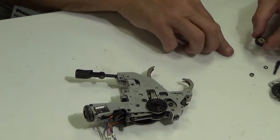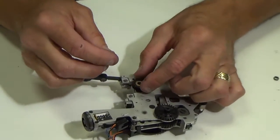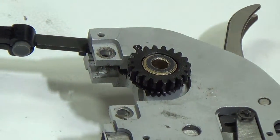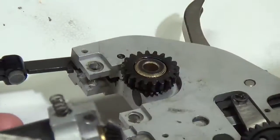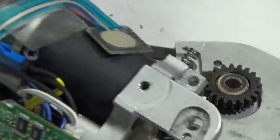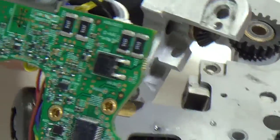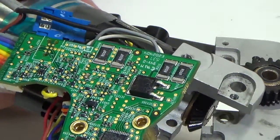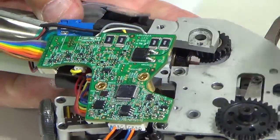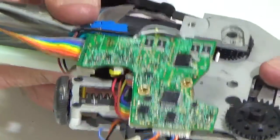The next thing I'm going to do after I have my gear on here is take my bevel spur gear, slide it there with my thrust washer, and set that right on the top. Then I need to grab the back of the tool — I'm holding the motor here. I need the spring that is sitting right here to get aligned with where this little nub is at on the rear jaw handle. I just set this on like so, pull it down, interlocking where the motor fits at the motor mount, and then just snap it together.